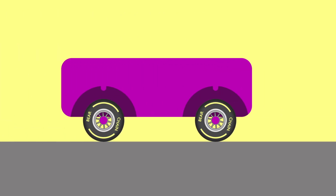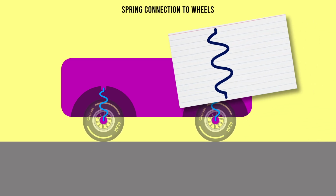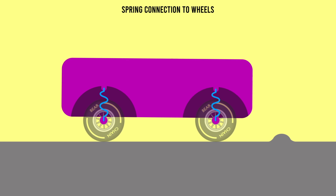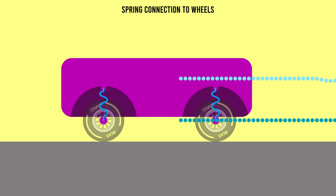So instead, let's start by placing a spring between the wheel mounting and the chassis mounting. A spring is cool because it absorbs energy via compression. If you load a force along a spring, it steals the energy into changing the shape of the spring, converting it into potential energy. This is similar to elastic, which stores energy via extension. Springs store energy via compression. So the spring reduces the force going into the chassis by absorbing it into its compressed shape. So while the wheel may still be kicked forcefully upwards by a curb, the chassis now sees less of that upward energy, so reacts more mildly.